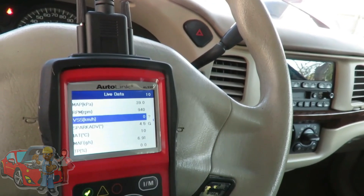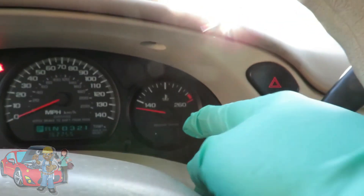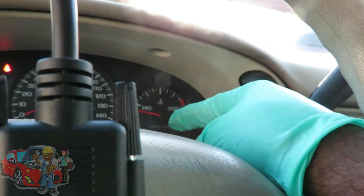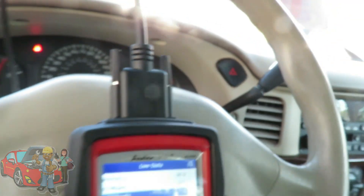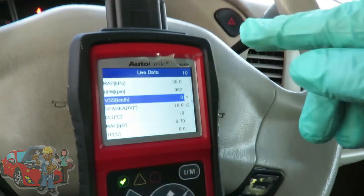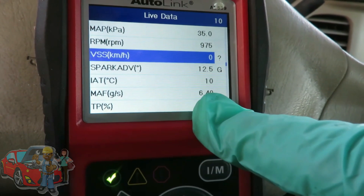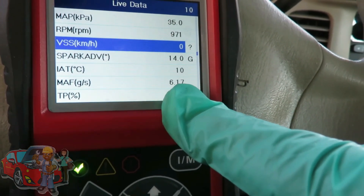The problem with this car is that when it warmed up, that's when the problem came in. So I'm going to warm this vehicle up — as you can see our temperature is way down there cold. It's like 38 degrees out here right now. Let's warm this vehicle up to the point where this mass airflow sensor is going to mess up. You can tell as this warms up, our number is going to go down — and you can actually see it going down already as the car warms up.